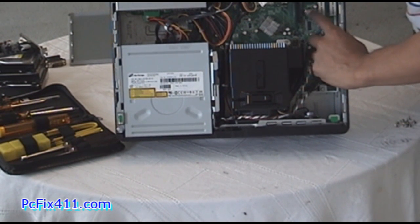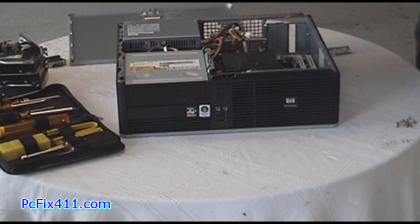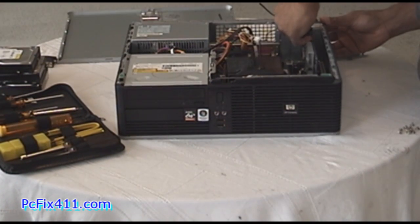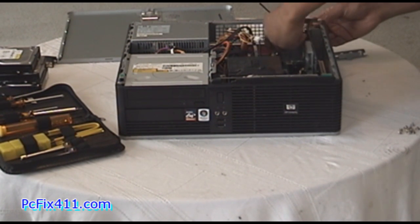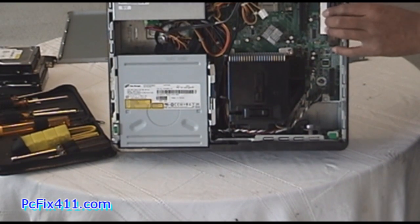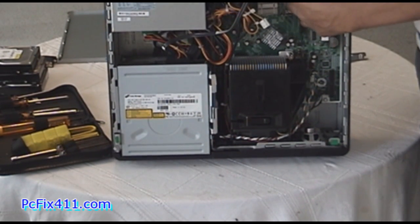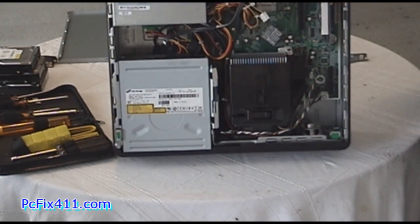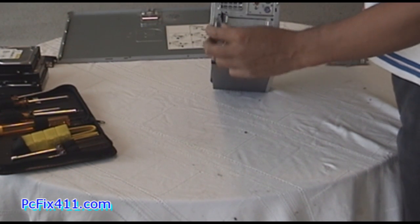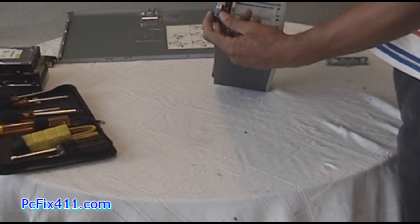This is the PCI slot we're going to install our PCI card into. I'm going to go in here, get this out, grab my PCI card, and slide it right in. The video card is now installed, sitting nice and snugly in its PCI slot. I'll show you the back of it — I had to custom fit this. The VGA slot is just going to come out here; there's no way it could line up properly in the slots, but this is the VGA slot I'll be using.